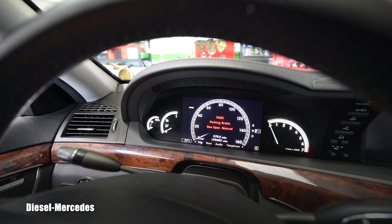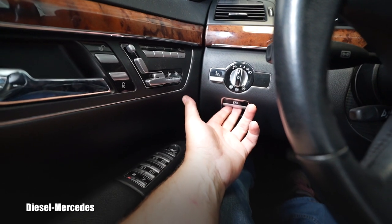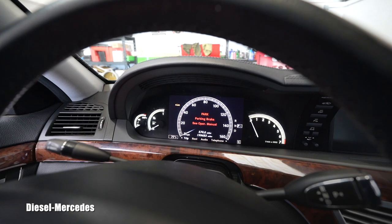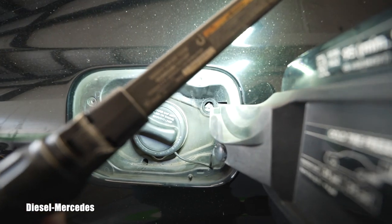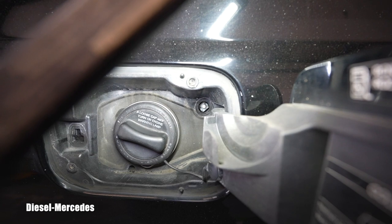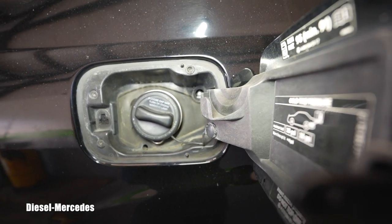Again pushing made noise, confirming the mechanism is being commanded but nothing is pulling the cable. I can see the cable is definitely being pulled in — it was sticking out more before. When I pop the little cover you can see in the upper right area — that's the emergency electronic parking brake release access point.